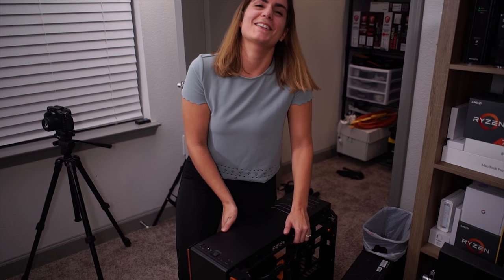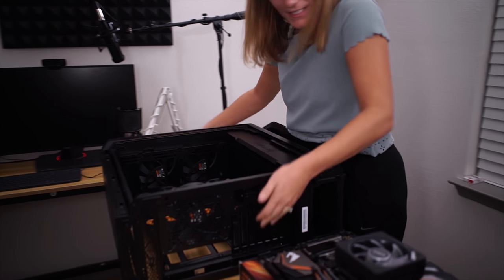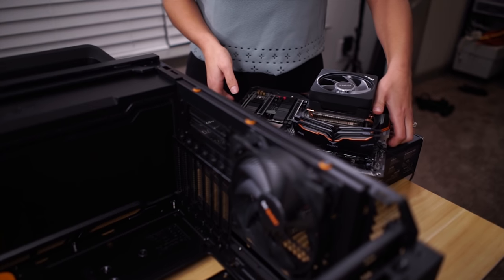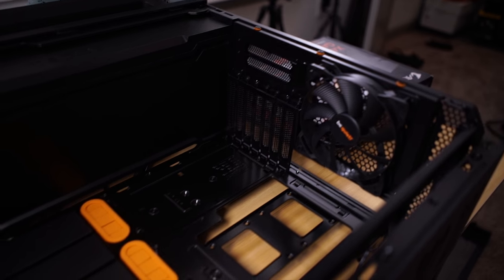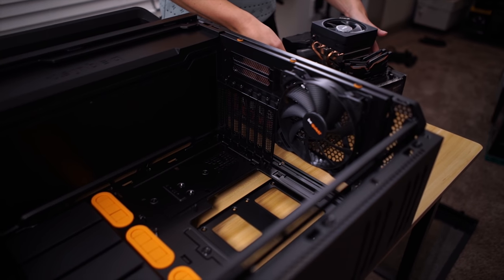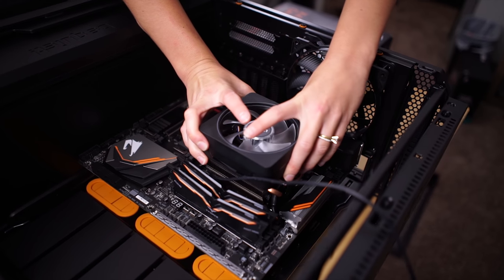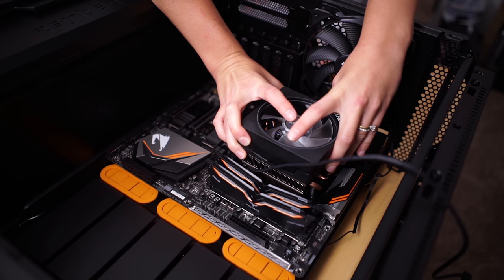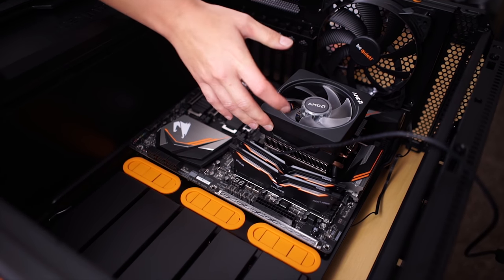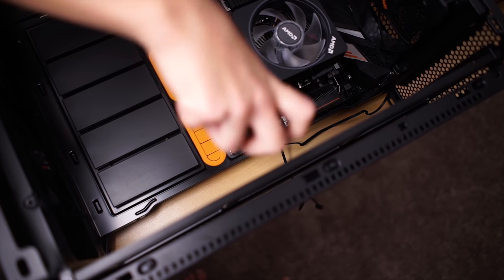Doesn't it look sexy? Oh my gosh, I think I need some biceps. I'm going to lay it down, I think, right? I like doing it this way so the screws are not disappearing. And this motherboard has an integrated back plate, so there's no need to push one into the case beforehand. You want to use the CPU cooler as kind of like a handle — don't hold the board, because you're going to have to push the board against the case. Okay, I totally get it. Like, it feels kind of sketchy, but that's the conventional way to do it. If you're not used to building a PC all the time, you're super sensitive with everything. Now I got it — this table is perfect height to build.